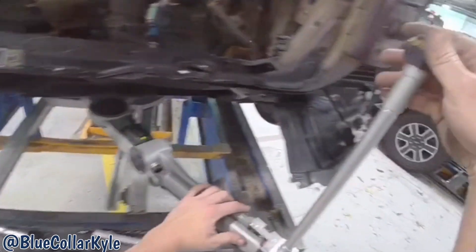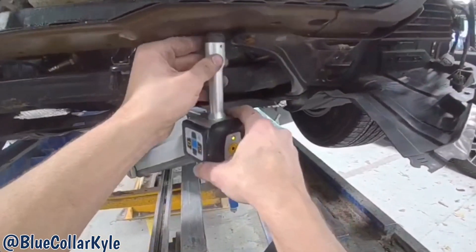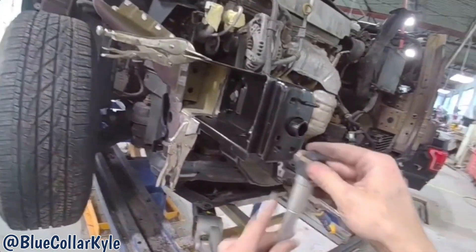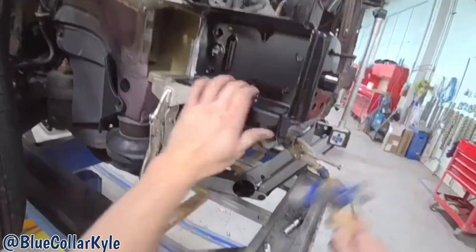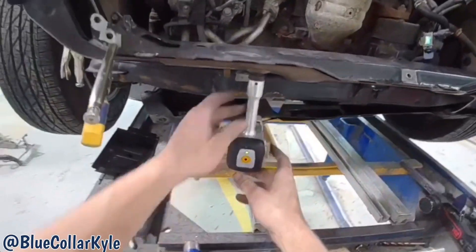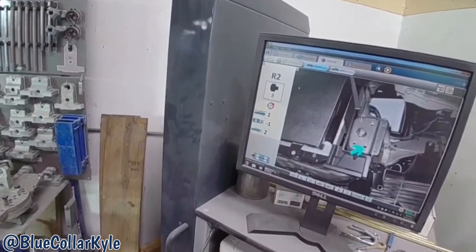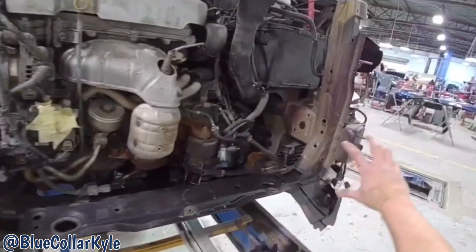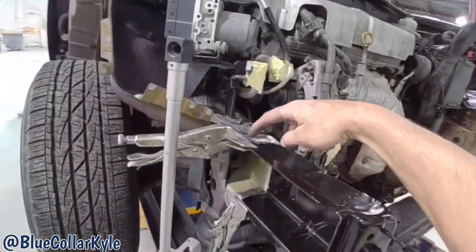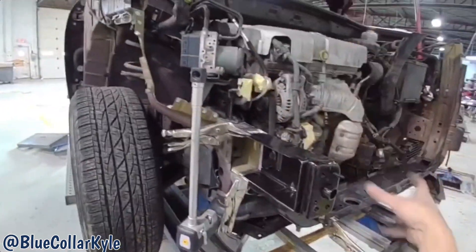The vehicle is all matched to the measuring system now. I'm checking this side first just to make sure it didn't move. All my points are measuring out within two or three millimeters, so this is sitting exactly where we want it. I'm going to bolt the bumper bar on there to lock everything in tighter, then weld this all the way around. After that's welded, I'll put the side plate on and get into the radiator support piece.